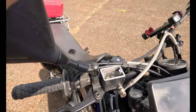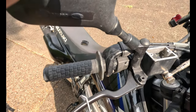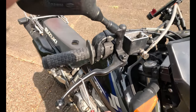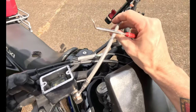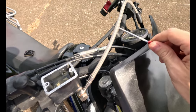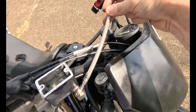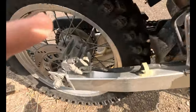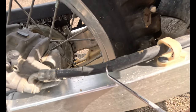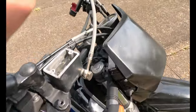If you've changed the fluid and everything on the brake lever is OEM and working properly, the next thing to check is your brake line. This is a steel-braided brake line — good for off-road, more durable against rocks, and tends to last longer than the traditional rubber-based lines. Those rubber lines crack over time, so if you have an old line you may need to replace it.